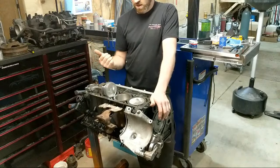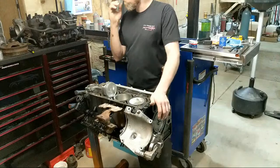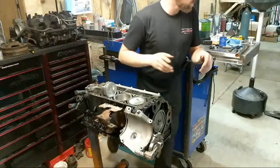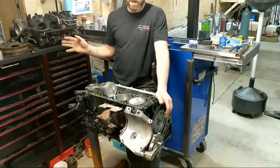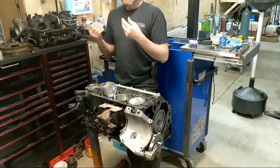Because of the cylinder heads I'm choosing alongside it, I'm choosing a very small chamber cylinder head - I'm using the 706 heads. I have three sets of heads here: I have the 706, the 862s, and the 243s. The 862s and 706 heads are pretty much identical - there's a little bit of difference in the casting process. The 862s are a rougher casting, the 706s are a smoother casting.